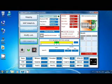Well, about the erase MIL on key-off, this one. Somewhat like the key-on one, but it's made on key-off. Obviously it works properly only in the rare vehicles that have a timer on key-off, where before turning off the power supply the OBD connection is still alive. I cannot simulate it in this demonstration because it's not so easy to find a vehicle that supports this kind of feature.